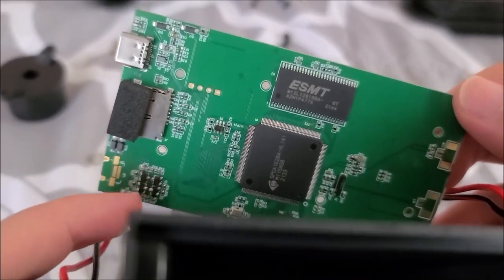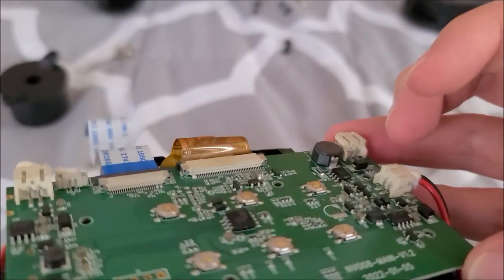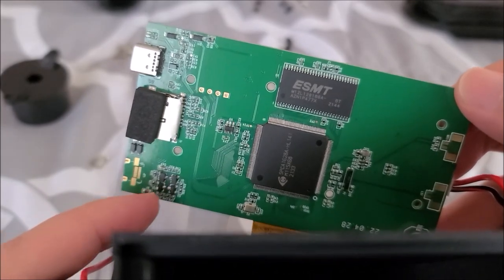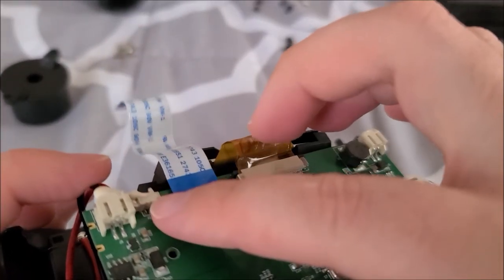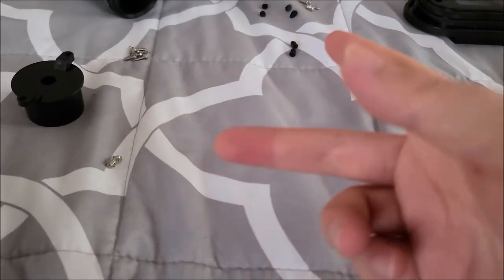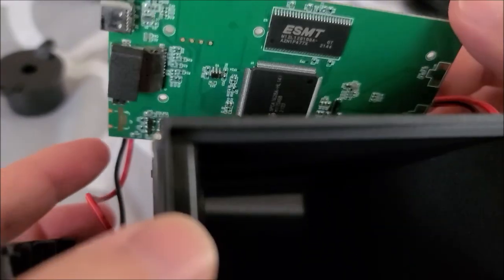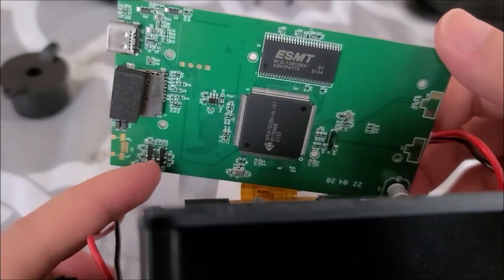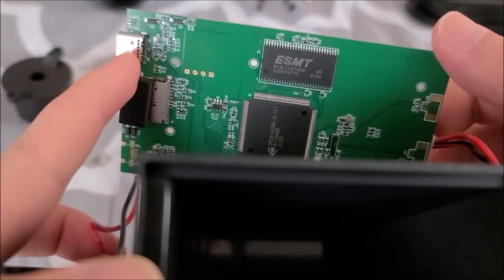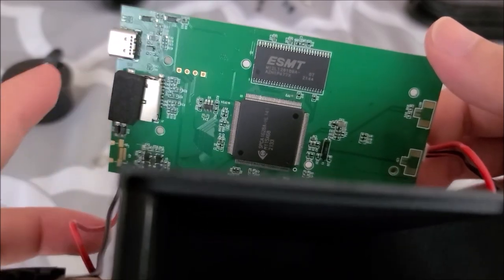And there are what appear to be transistors right next to it, a whole host of them. Oh no, that's probably an H-bridge. Yeah, that's got to be an H-bridge to drive the shutter, because you drive it in one polarity to close it, and probably the other to open it. It's probably bistable or something like that. So yeah, that's got to be an H-bridge right in there. Power regulation, here's the micro SD card slot, USB-C input. I could see some power-like stuff there.